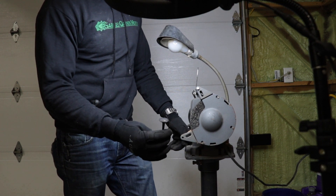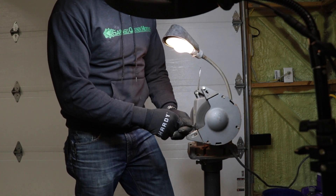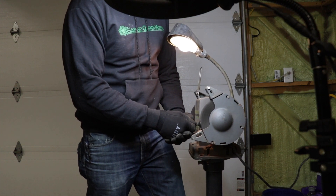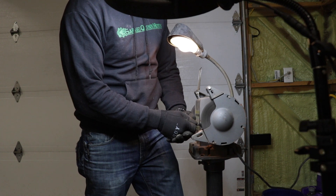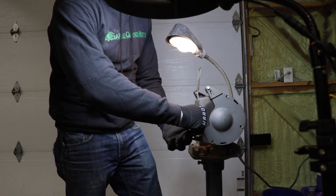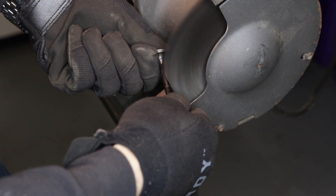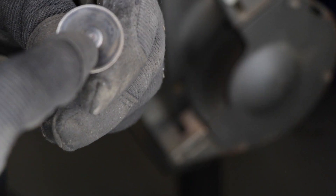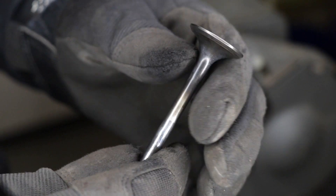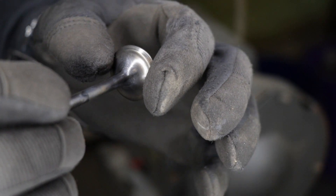It's not going to hurt the valves — the valves are very hard steel — but we want to make sure that we get all that loose carbon off. Whoa! You've got to press hard to get the loose stuff in the middle because there's an indent, it's not flush, so you've really got to put a little excess force in it. There we go. Better. Now the scary part is the sides. For this center section that's actually indented, you saw me really pushing hard. You can see the backs here nice and clean, nice and smooth. Once we're ready to put everything back together we'll do light lapping just to get everything flush. And now we're good.